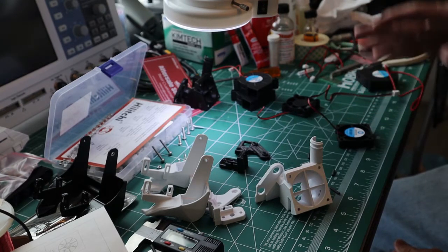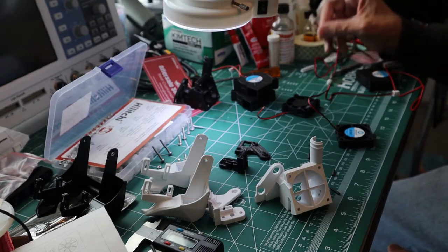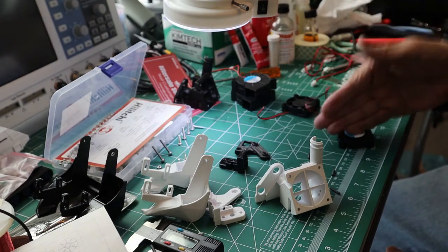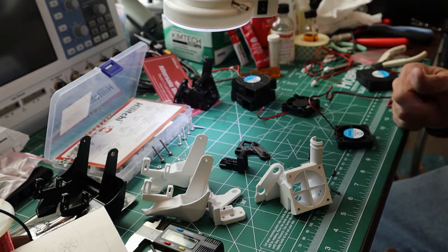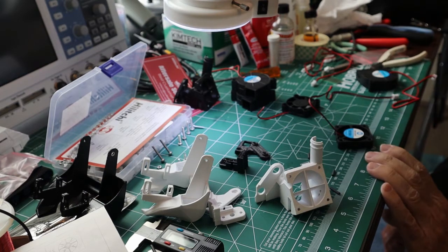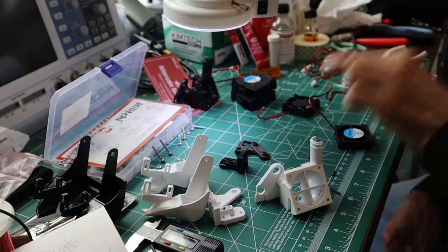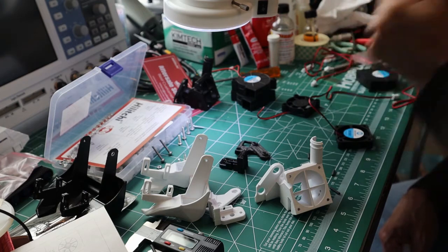Be very aware of that. Don't use one connector as your guide. Make sure that you are wiring specifically to these motors, and when you get to the printer you shouldn't have an issue. Just as long as we're aware of it, we can make sure that during installation plus goes to plus, minus goes to minus, and everything is okay.